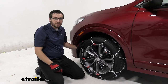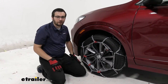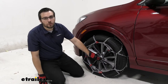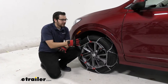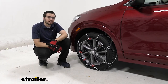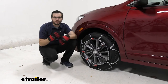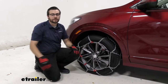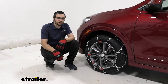Just a nice way of getting that traction control. One great thing is it's not going to take too much time to install — we don't have to get on our hands and knees too much, as we can make most of the connections right here on the front of our vehicle. Before we show that, let's make sure we're getting the right size. We're working on 225-55R18 tires, so make sure you put that in the fit guide at eTrailer.com. Also, a lot of our Encores come with front wheel drive, which is why we've installed it on the front wheel. If you have an all-wheel drive package, you can probably use them on all four tires — that's your best bet. There's varying consensus on placement for AWD, but if you want to play it safe, two pairs is the way to go.